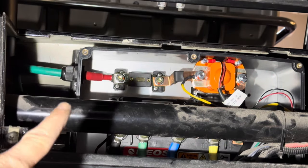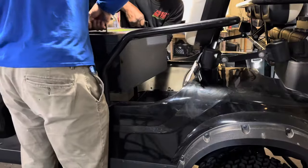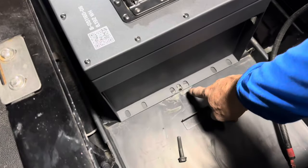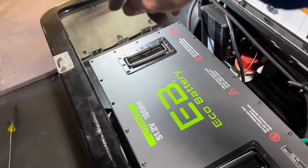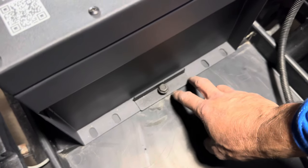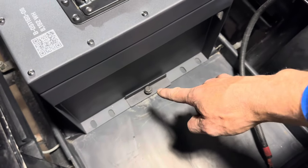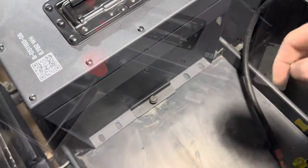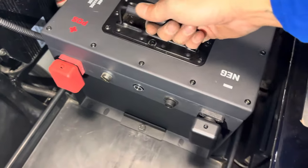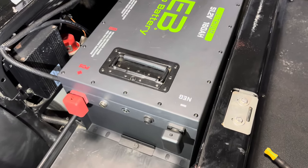Here's a look at the finished main positive wire replacement. Now we can put everything back together and get the battery put in. When you drop your battery in, the holes will line up with the center hole and on the other side. The bracket will help reinforce the thinner metal on the bottom of the battery to keep it from flexing or bending. We'll go underneath and use our locking nut to secure the hardware and bracket down to the battery tray. We only used one mounting hardware on each side, but it is very secure with no wiggle room — and we didn't have to drill anything extra into the cart.